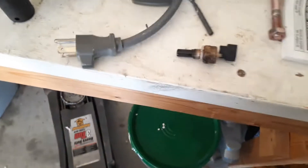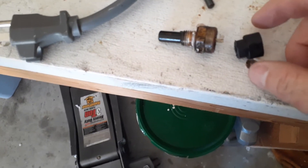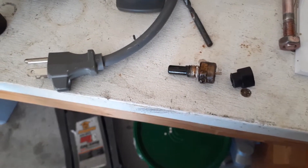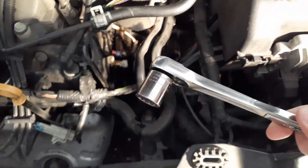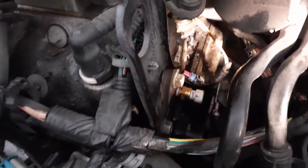There's the old part right here. I ended up busting this thing off. I was trying to figure out how to get it off because I only have a 19 millimeter long extension. So I went and got my short wrench out — three eighths and a 19 millimeter socket — and I pulled that out. It's just on the side here. There's your throttle body right there — it's right below your throttle body.